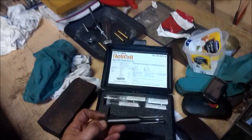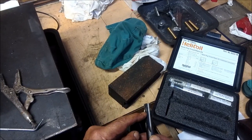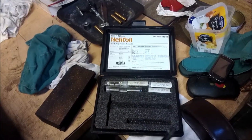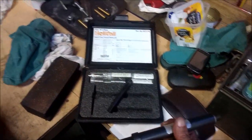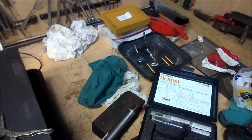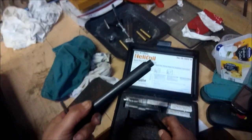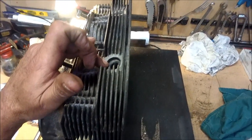Helicoiling - just to show you, here is a helicoil tool. A helicoil tool is in two main parts. The main tool consists of in this case a 14 millimeter spark plug thread and then a larger cutting tool which eventually allows the helicoil to pass through. Those are the little helicoils in different lengths. The second tool - you set a collar for the length of the tool you're going to insert, then you wind it into the head, undo the collar, wind it out, and then break off the end with a pair of pliers.